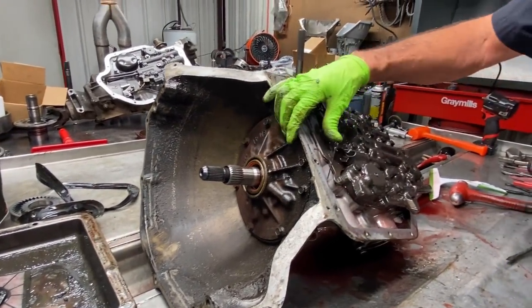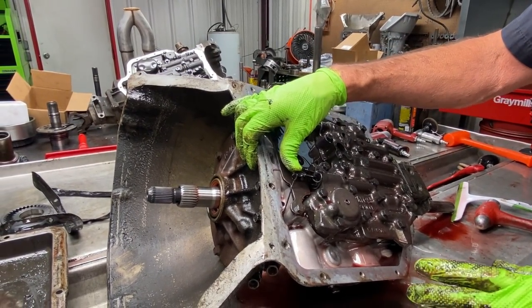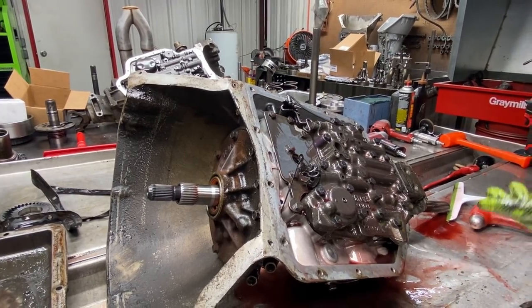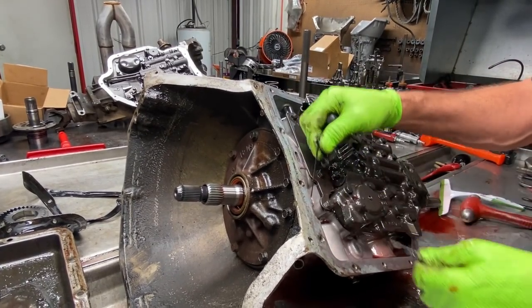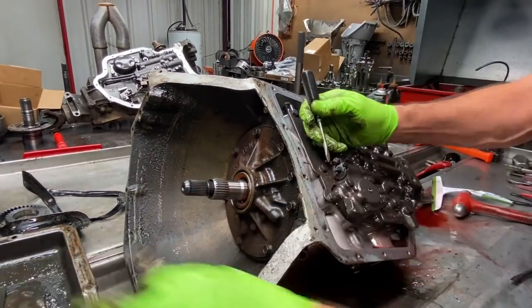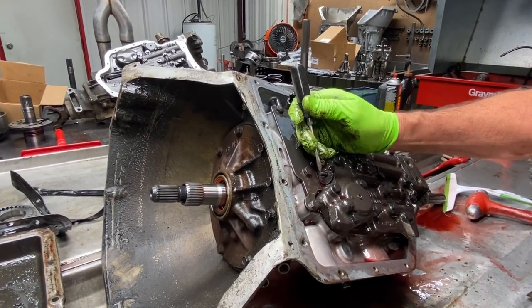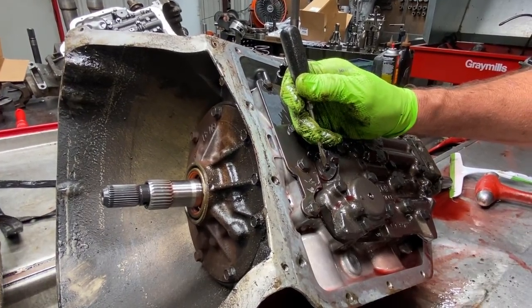And we have our passing gear linkage here. When you push the gas pedal to the floor, it pushes this to the floor. You let off the gas, it comes back. Now when we go back, if he doesn't want a passing gear cable put on this, and we block it, we'll block this lever back right here. This has a two stage to it. It's kind of soft and then it gets hard. Soft, stops, and then there's another spring that's hard.